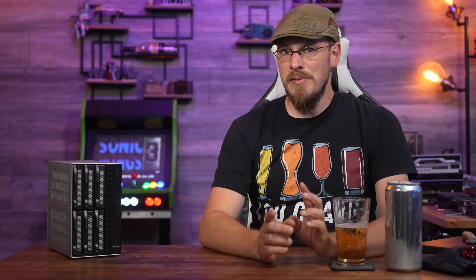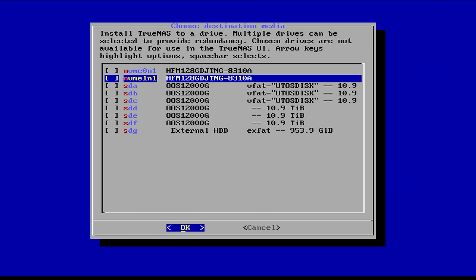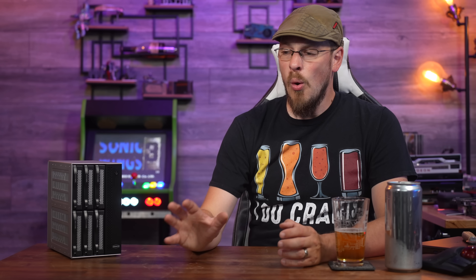So if I can't run TrueNAS from the pair of NVMe drives, I could probably just install it onto the eMMC that the T6 wants so desperately to boot from. But let's rewind back to when I installed TrueNAS for the first time. See the install disk selection screen? There's no mention of the eMMC drive listed there. So not only can you not set a custom boot device and make it stick through a reboot in the BIOS, you also can't overwrite the eMMC from outside Terra OS or their install wizard. I even went as far as to rip the BIOS off this device and edit it with the AMI BIOS editor — the same I've done for X79 and X99 Chinese market motherboards — and I could not find one reference to why it keeps returning to default settings or disabling my NVMe drives as a boot disk. I spent hours trolling through this BIOS and could not figure this out.